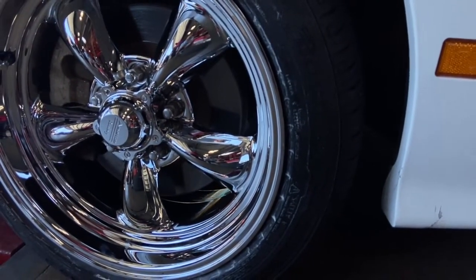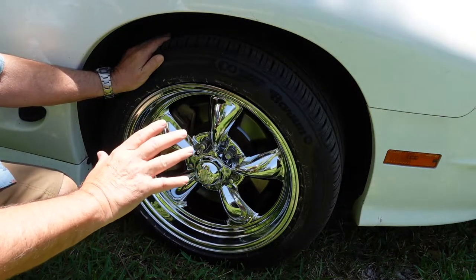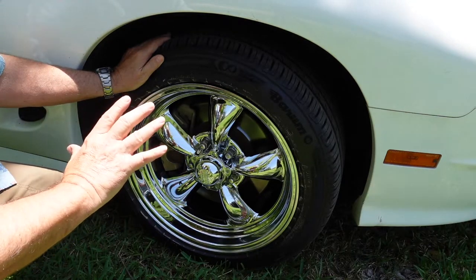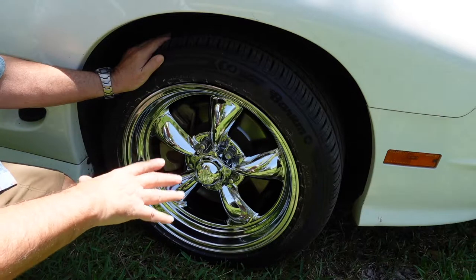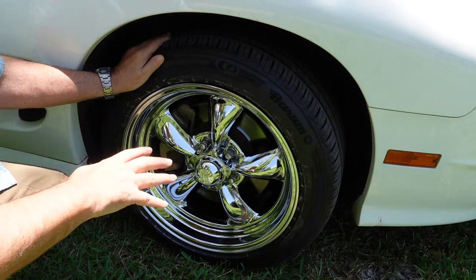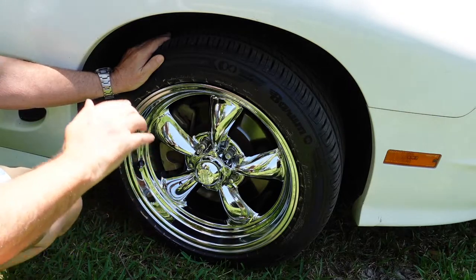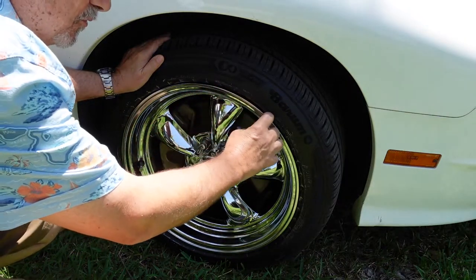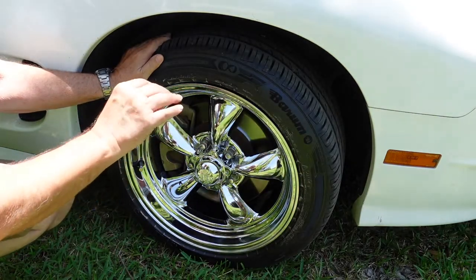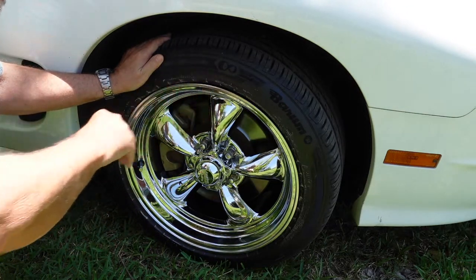I had to film this kind of in the shade because these things are very bright. I had wanted to get aluminum cast wheels, but these came in as chrome — that's why they're so bright. I wasn't really crazy about that because, from my experience, chrome wheels over time will start to corrode right around the bead line, and eventually that chrome will peel off and you'll have a hard time setting the bead on your tire and it'll start to leak.